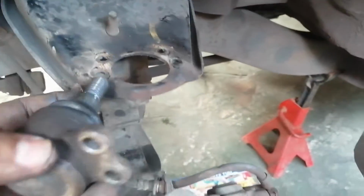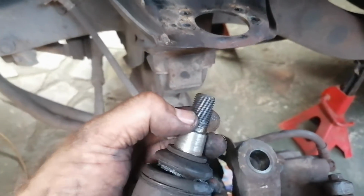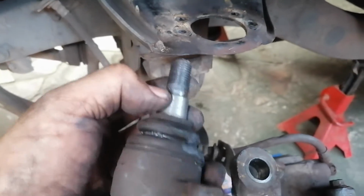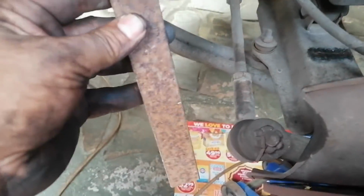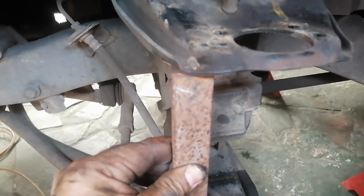So anyway, to get this out, I obviously loosened up these M8 bolts on top here, bolt and nut. Actually, I first loosened this nut here. So I suppose one could loosen it till it's halfway down or whatever, or take it completely off. Then I loosened these 4 bolts. I took this jack and I took this bar and I stuck it on the jack and pushed up like that on here, you know, pushed this up on the jack.